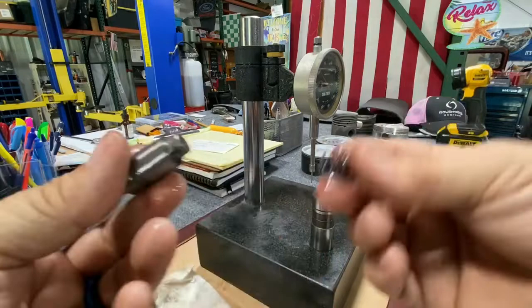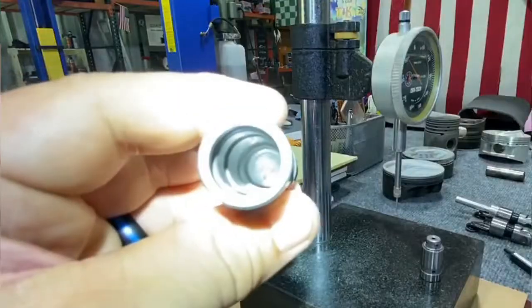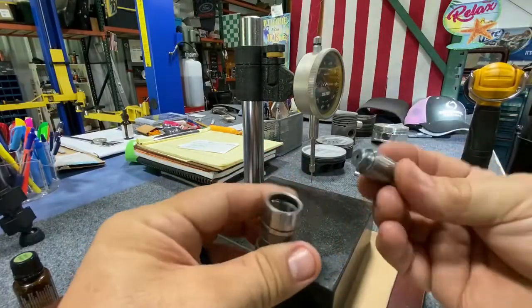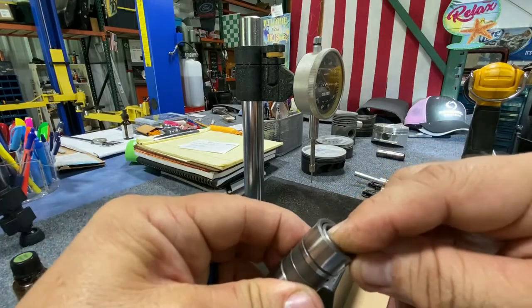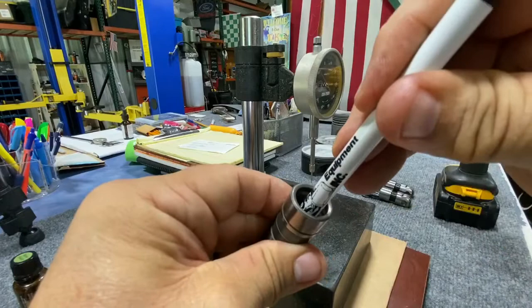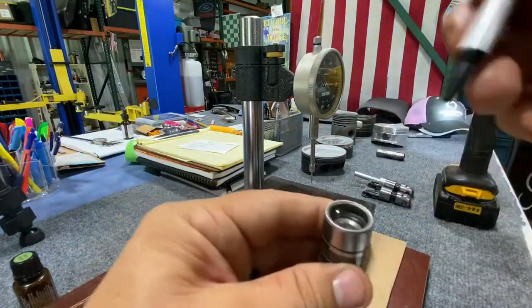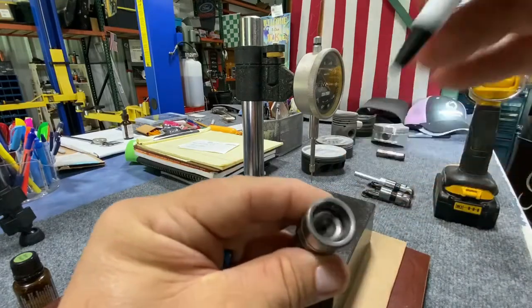What I'm going to do is leave the spring out and put this back in. I washed it out really well with lacquer thinner — that's what it looks like down inside the hydraulic lifter. I'm going to take the plunger and push it down until I get all the air out, then put the plunger cap in. It's in there and it's solid.